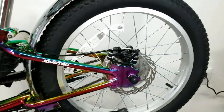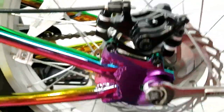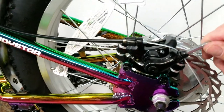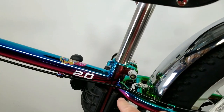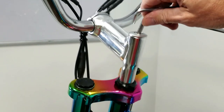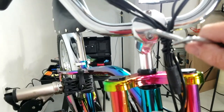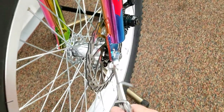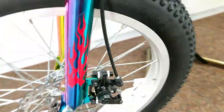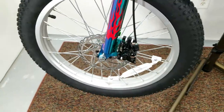Before I take the bike off the stand, I do a double check. Make sure my axles are tight, double check that my brake cables are tight, check the seat post — you don't want that sliding. Double check that your stem is good and tight — that's a six millimeter up here. Make sure your handlebars are put on tight. Front axle, 14 millimeter — those should be tight. Then check your brakes: make sure they're tight at the mounts and are functioning correctly.